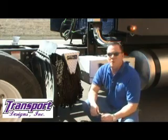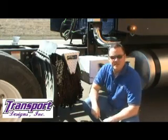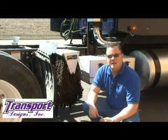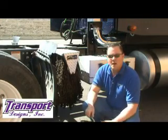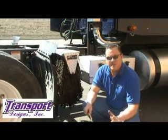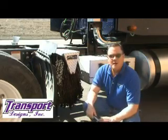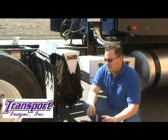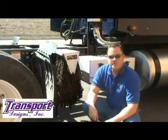The other thing that guys won't take the time to do when the weather's nice like it is now is take the chains out and check the count and condition. That's another huge problem. So take the time when it's nice like today. Lay your chains out, make sure you have no broken links, make sure you got the right count and condition, and life will be a lot smoother.